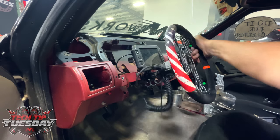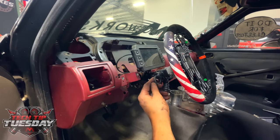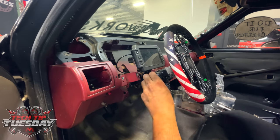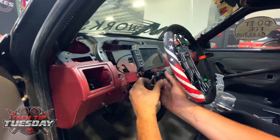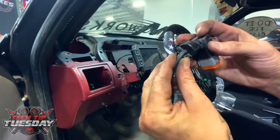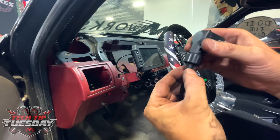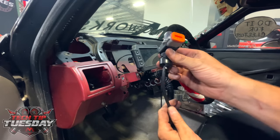The other thing that I forgot to do is on this Monocord Pro, we have an attachment point right here. That's designed to attach that cord and give it a true strain relief. As you can see, or you can't see, I'll take it off for you. This is meant to have a zip tie on it, so it's basically a half moon, and it pinches it in there so that all the strain is right here rather than on the actual plug wires themselves. So I'm going to go ahead and shorten this.